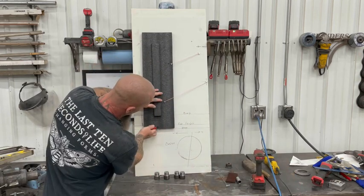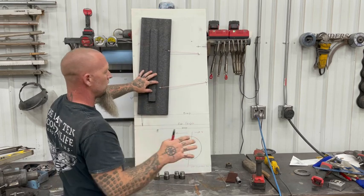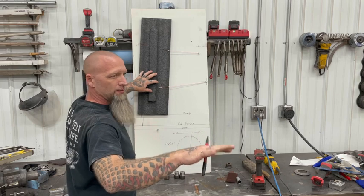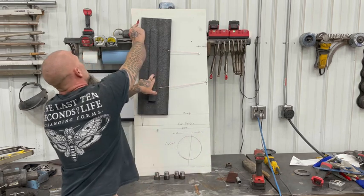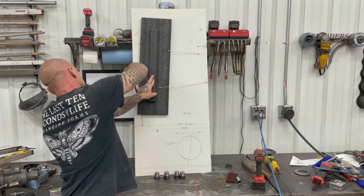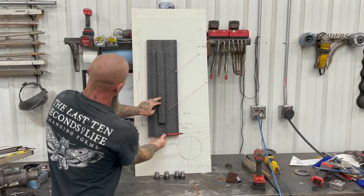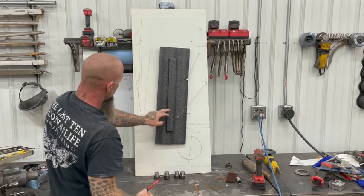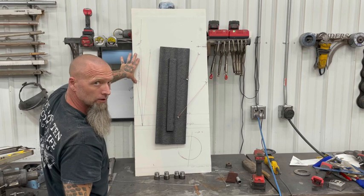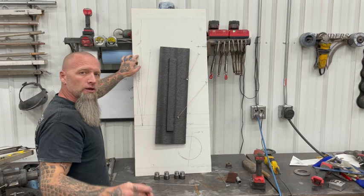Okay, so when we come into bump, you heard me say earlier that when I dive into a corner, I'm planning on right around 5 degrees of body roll. So, this is a bump. We'll just go ahead and draw it on in there. You can see I went negative on my camber here. This is going to be important.